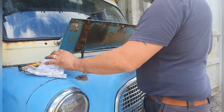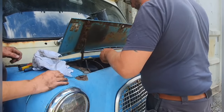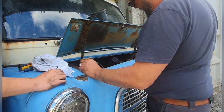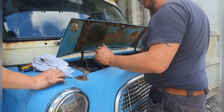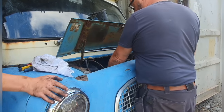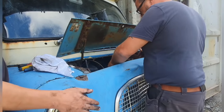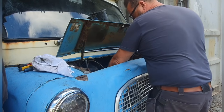Dry. There's no fuel getting in there for some reason. Right. Let's just double check the spark again. You want to spin it over for me in a sec? Go. No, spark's gone now. Ah, interesting. That obviously would not help the cause, would it? No. Okay, so we need to have a look at the points again, which means taking that lovely cap off. Right, cap's off.